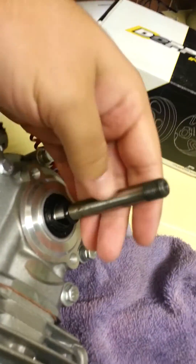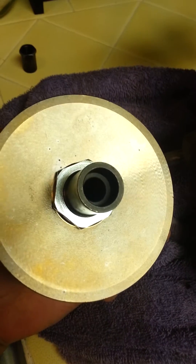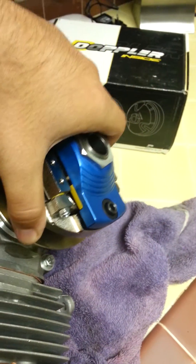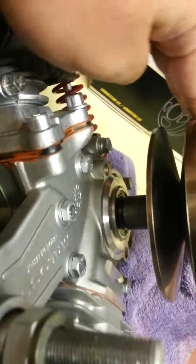There's kind of like a keyed weight right here. I know that's more for the original clutch setup. On the ER3 it's not keyed in any way — it's just a hole that slides over that. It doesn't seem right, but the only way I can see this is if you put the ER3 on there. As you can see, it's rotating but it's not rotating the crankshaft.